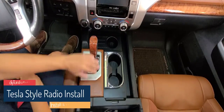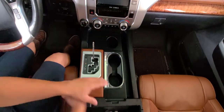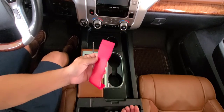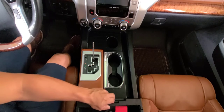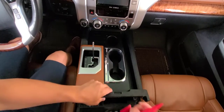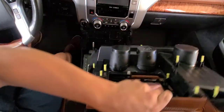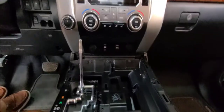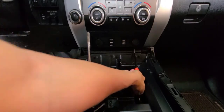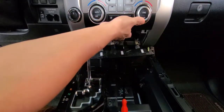The first thing to do is remove this console. Start by removing the cover from this area — you can use your hands or a trimming tool to facilitate the process. This is one single piece; make sure all pins are in place to pull the whole thing to the outside.